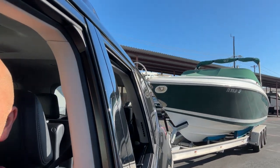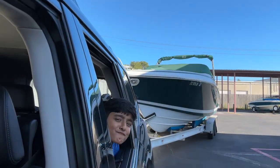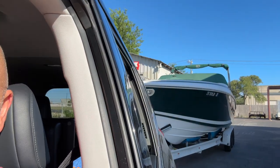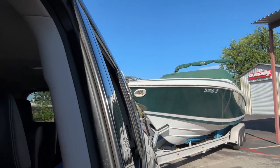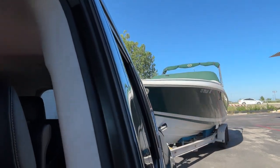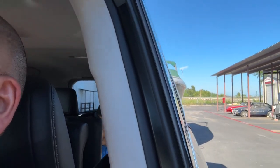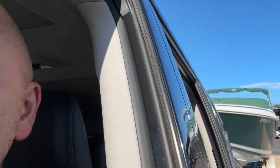There she is — making our way out of the storage facility. You always got to take wide right turns and left turns with these triple axle trailers, because the tires will try to kind of bend sideways as you're turning. So you don't want to take tight turns when you've got a triple axle trailer. Even on a tandem axle, you want to avoid real tight turns. If you've ever busted bearings on a trailer, one of the things that damages them pretty quickly is those tight turns.